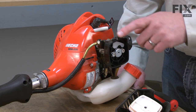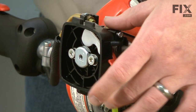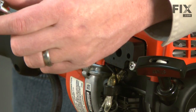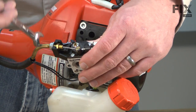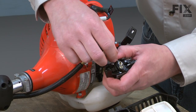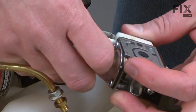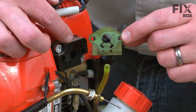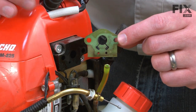Next I'll remove the air filter bracket as well as the air filter base. They're secured with two screws. Now remove the throttle cable and the fuel lines from the carburetor. Between the carburetor and the isolator block is the intake gasket. That'll usually just fall away or you may have to pull it or scrape it away from the isolator block or the carburetor.